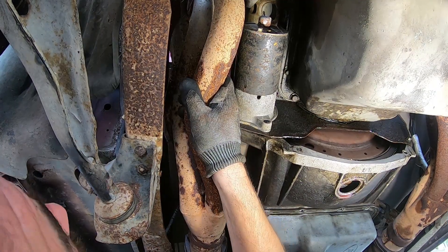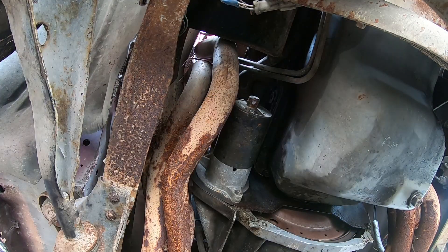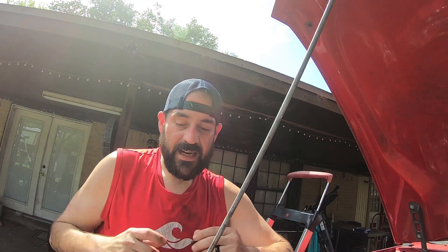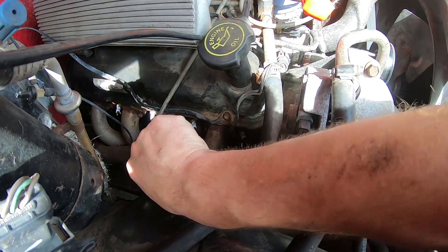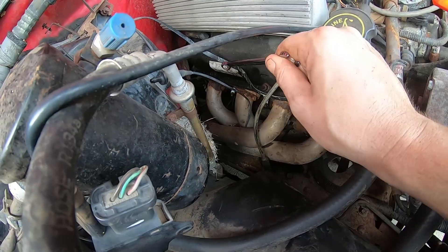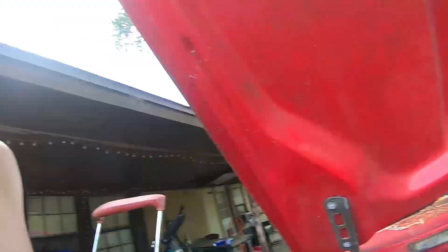The exhaust is right in the way. That starter is buried behind the aftermarket exhaust and I don't know how to get to it, so I'm going to pull off that header to get it out of the way. I've been really overthinking these header bolts — three-eighths studs, 12-point. There are a couple tight-fitting ones in there. You just need your box-end wrench to get into the tight spots. I've got six left to undo, then I'll go underneath to unbolt — that'll also give me access to the transmission lines and all the other stuff they rigged up in here.